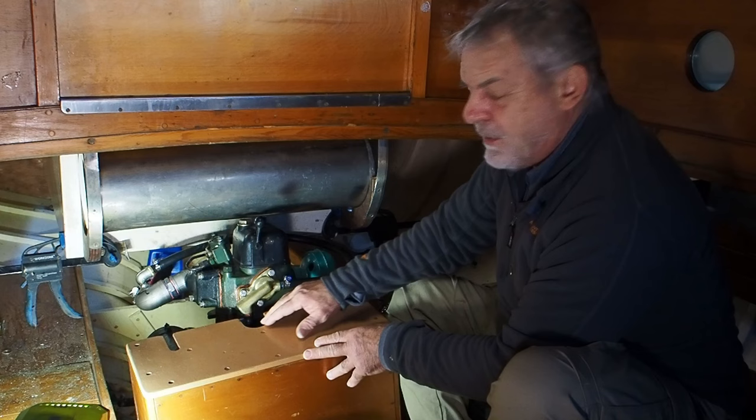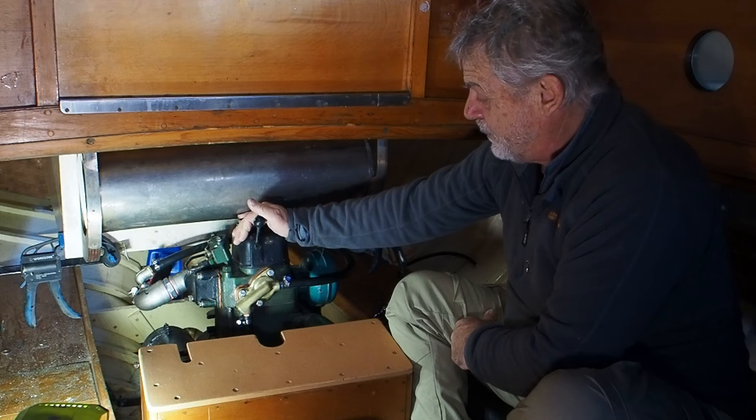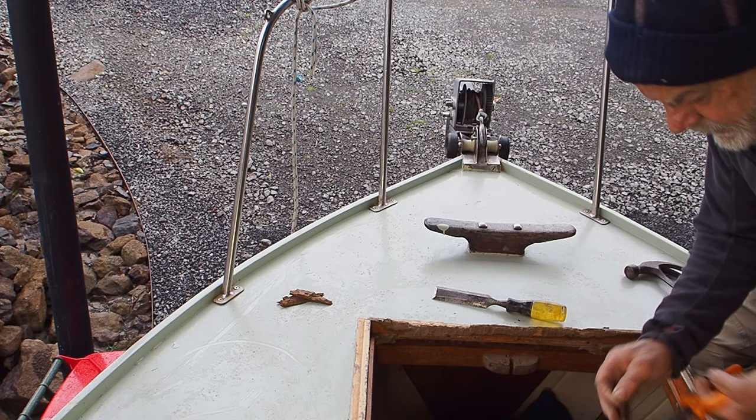I'm told that if you have a nice high cranking battery, which I got a big powerful battery, so it should work, that you actually don't need to manage the decompression on this because you can start it with the compression lever off.